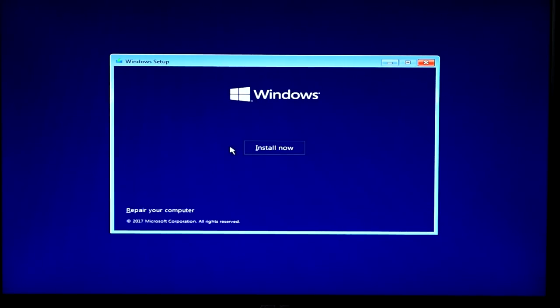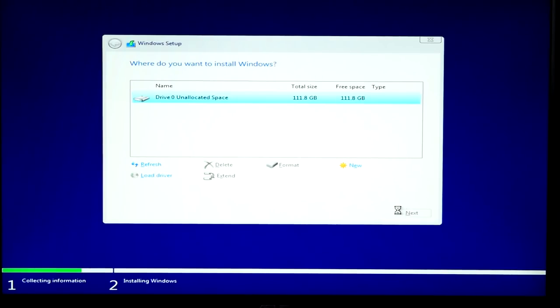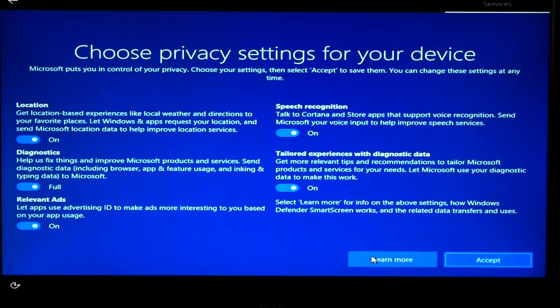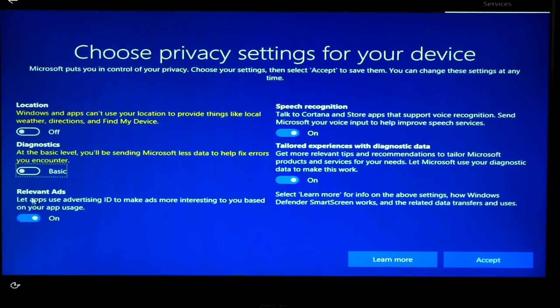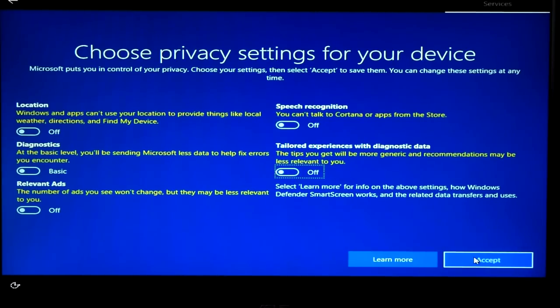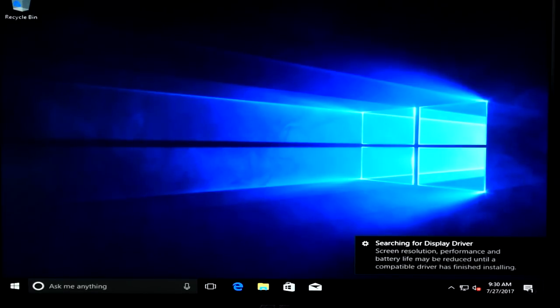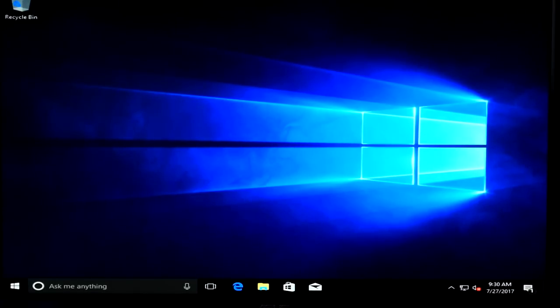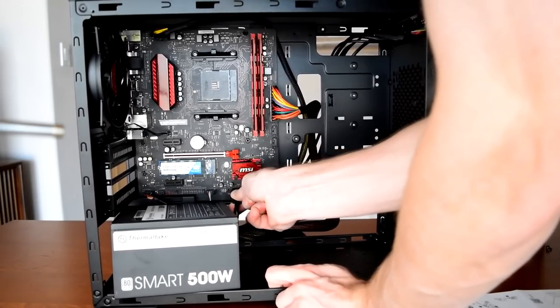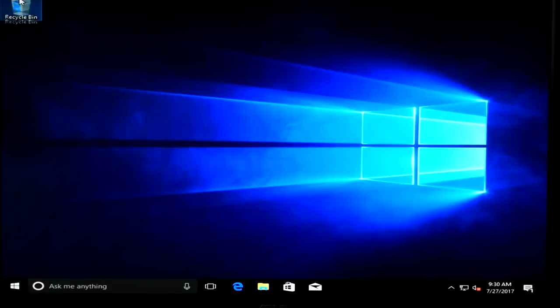Installing Windows 10 is, as always, a really straightforward process. It's especially fast now that I got a SanDisk Ultra Flair thumb drive which promises — and actually delivers — 130MBps reads. I'll add a link in the description. As usual, I turned off all the telemetry options while installing. I've had pretty consistent problems with telemetry apps in Windows 10 hogging the CPU, hard drive, or network, so I would highly recommend you turn all these off. With the options all settled, I let the installer get to work. And there it is — the Windows desktop. I was especially relieved to see this because of that USB 3 header that I broke; I was more than a little concerned it would cause problems or outright burn something. Thankfully, no problems.